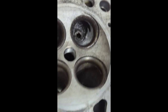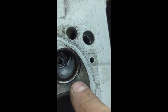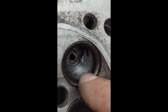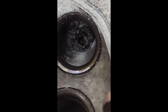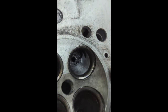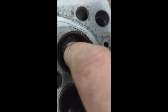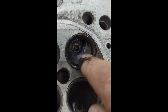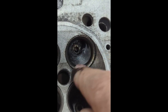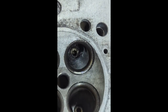Here you can see what I'm doing with the carbide bit — basically roughening up and taking off some material just to get a smooth, even surface, taking all the debris and carbon out. There's a sharp edge here. Just take your time and be careful not to mess up the valve guide or the valve seat — you don't want to be hitting that, otherwise it'll damage the valve seat. Just slowly going in there, grinding away.